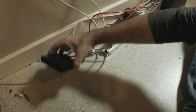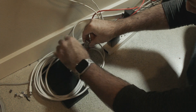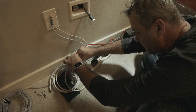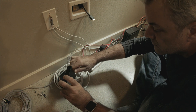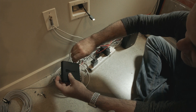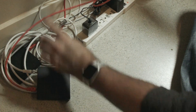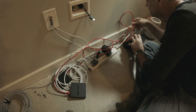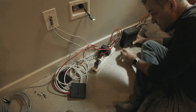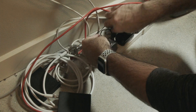This will all be behind my screen wall when the theater's built. There's the Duo and the Flex 4K that's going to go right next to it. I did have an extra RF cable on hand and pre-installed the splitter for ease of installation here for the camera. One thing of note: I do have an amplifier in the wall. If you don't and you're splitting your signal to one or more tuners, you may want to add an amplifier if you notice degradation of your signal quality. Once the antenna is connected to the Flex 4K, you'll want to connect an Ethernet cable and get it plugged into the same network as your Plex server and streaming devices. That's really it for the connections — I'm going to give it some power, let it boot up, and then we'll jump into Plex.